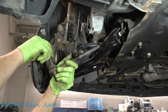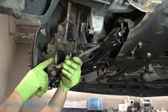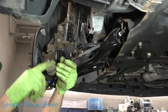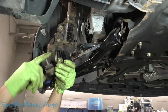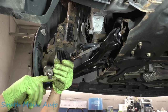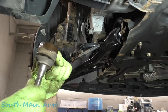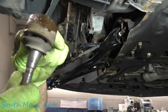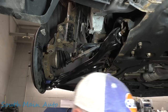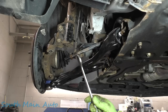Let's count our turns. One and a two and a three... all the way to fifteen — and it fell off. So this one's pretty clunky, you got some play. Fifteen turns. Let's make sure our jam nut's loose, because we love our alignment guy.